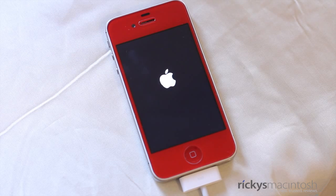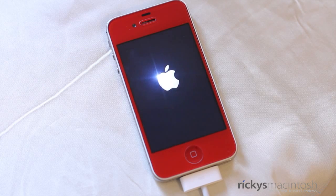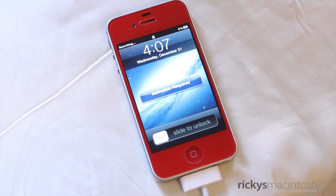Now we have the completed iPhone 4S color conversion kit. Before you do anything else, make sure you power it on and make sure everything works. Check the proximity sensor, make sure the camera works, make sure you still have a signal with your carrier, and make sure the Wi-Fi signal works. Thank you guys so much for watching this video. I want to say thank you to iPhone 4 Parts — I really appreciate them trusting me to do this video. Click on the annotation there to subscribe to my YouTube channel, and I will see you guys in the next video. Talk to you guys later, bye-bye.